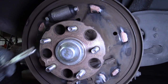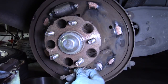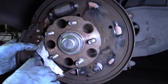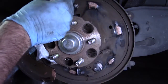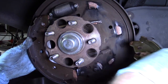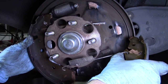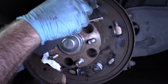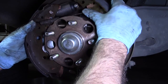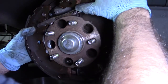It looks like I've rubbed my other grease off in the process, so I'll just re-grease inside the forks and put this thing together. I'm going to hook the parking brake cable back on, bend this little spring back, and come in here and get it on. Put the self-adjuster in — the wide side goes here. And I've already got the spring in this shoe. If you forget exactly which hole the spring goes in, just go look on the other side or refer to your picture. I remember on this end the spring hooks in that hole. So I can just get this into the self-adjusting mechanism.